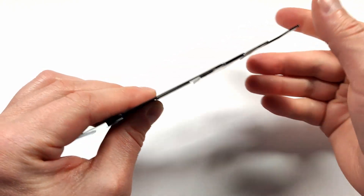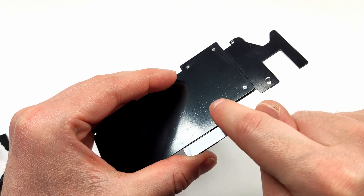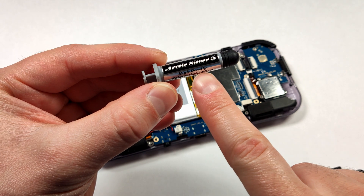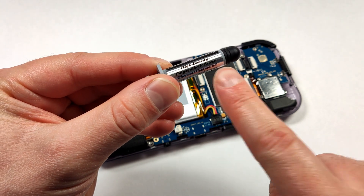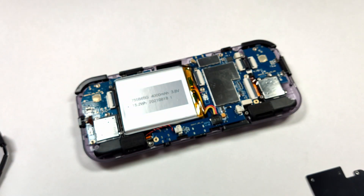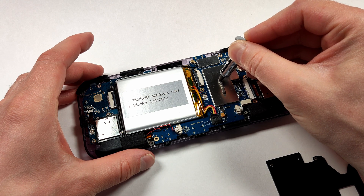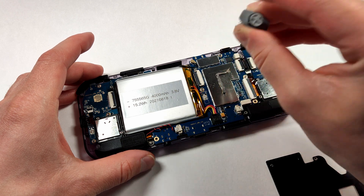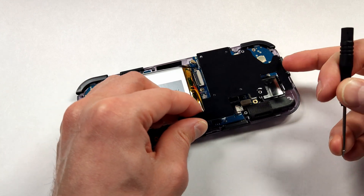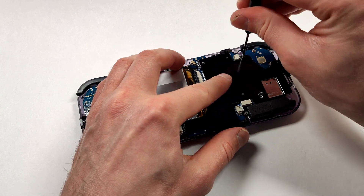The bottom is going to sit on top of the heat plate directly above the SoC, and all we have to do is remove these four screws to get this side off. For the thermal paste, I'm going to be using some Arctic Silver 5 — this is all I have available on hand right now, but it's excellent paste and it should do nicely. When applying this, I'm just going to put a line straight down the center. Thermal paste is non-conductive, but I'm going to be careful not to let any spill over the edge. All I have to do now is put the heat plate on top — tightening these two screws should spread the paste out.